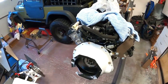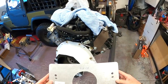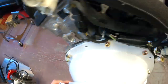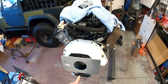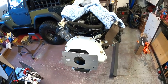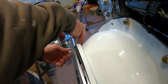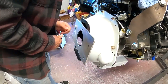The T56 — you can't index off the bell housing like a normal transmission, so you have to buy this plate, about $70. This thing actually bolts up in here like so, and I've got to put four bolts into it, then we can index off it. That's how you index a T56 Magnum transmission. I've got to find the bolts for this — making sure they don't come into contact with the bell housing back there so you don't scratch the paint. That's why I had to go shorter than the ones that bolt to the transmission.